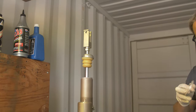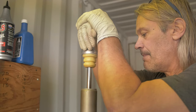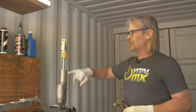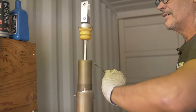With the shock spring removed, I always like to check the action of my shock — just to make sure that it compresses and rebounds well. If it doesn't, I know there are issues with it. Next, I'll take a hammer and chisel and remove this end plate here, doing it gradually, a little on each side.